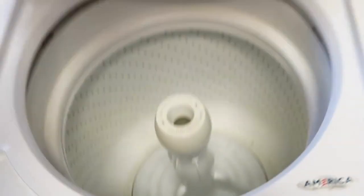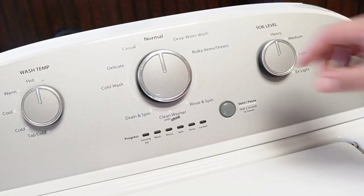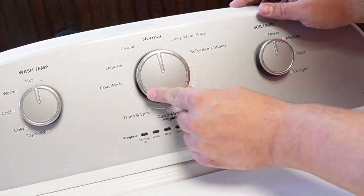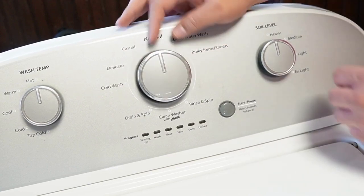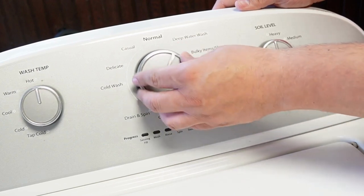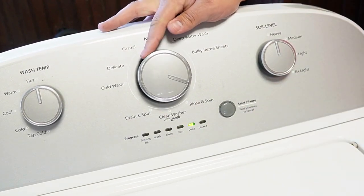Now that we've done the first reset, let's go ahead and attempt to recalibrate this washing machine through the calibration mode. This is a must-do if you've installed any new parts on the washing machine, from a board to a balancing rod. With the washing machine freshly rebooted, rotate the dial again counterclockwise 360 degrees. Then turn the knob right three clicks, left once, then right once again. You need to do all these things within three seconds, and it may take a few attempts. If you've done this right, all the lights at the bottom of the washing machine control should flash on and off, showing that you've entered into the diagnostic mode.